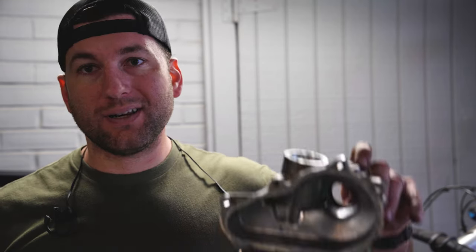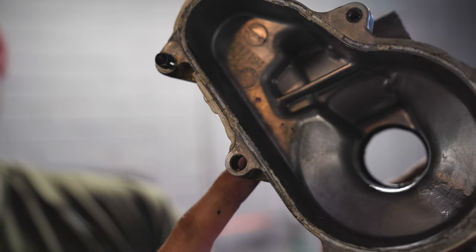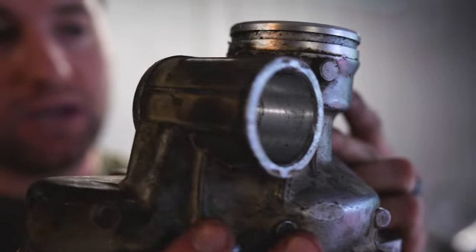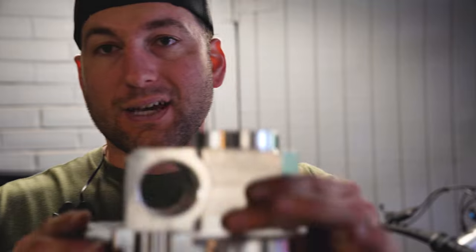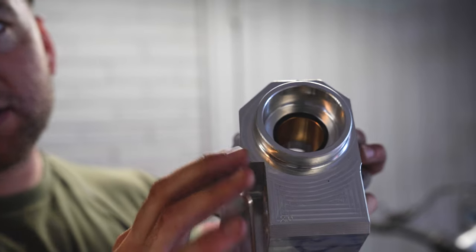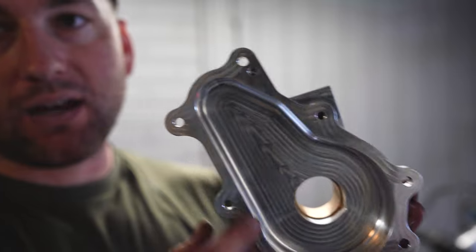I apologize for the lighting and this location, but I just want to show you the difference between the stock end cap and the upgrade. Look how thin that cast is — it's not robust at all. They took as much metal away from this as possible, so it's very thin and for the part, very brittle. That's the factory steering end cap. And then this is the 74 Weld end cap. As you can see, they did not remove excess metal — all of that is there to provide more support. It's all billet aluminum rather than cast, which is stronger already, and the walls themselves are thicker.